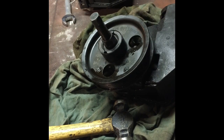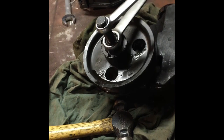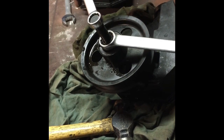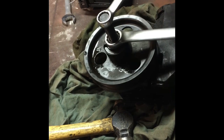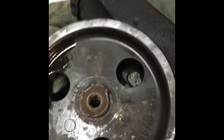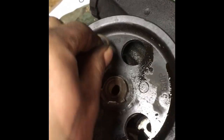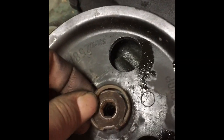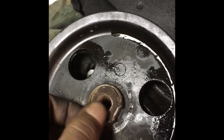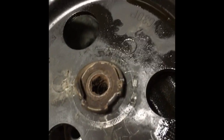Now that you have your tool on properly, go ahead and take your wrenches — there's the lower nut and the upper nut. Put them on there and tighten. It can get quite challenging. Sometimes things don't always work out to plan. You can see the little lip on this collet here — it's two halves, obviously — it goes around and goes underneath there like that. Well, this thing's seized on there. As you can see, there's the remains of that lip that was used to pull the pulley off. So looks like we're running to get a new pulley. Not everything goes to plan — apparently this thing was seized on there a little more than we expected. Off to get a pulley.